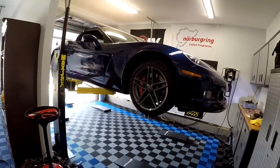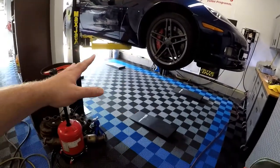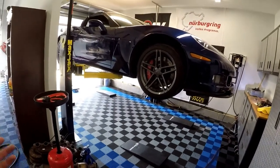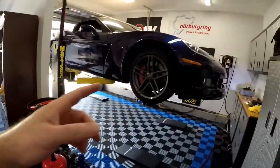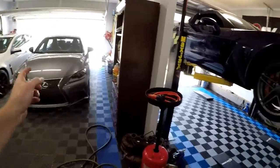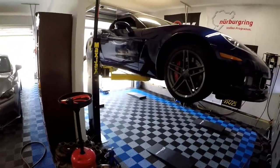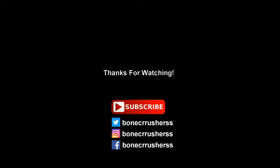Long story short, that's how to raise a lowered Corvette on Max Jacks. I hope this video helps you make your decision if you want to buy Max Jacks and you've got a lowered Corvette - it's a little bit of extra work but you can get the car up in the air with no problem. I've done clutch swaps, two supercharger installs, and brakes on both the SS and the Corvette with it. The Corvette and the SS - the Zeta chassis - has flat spots where you can put the arms with no issue. Thanks for watching, don't forget to like and subscribe.